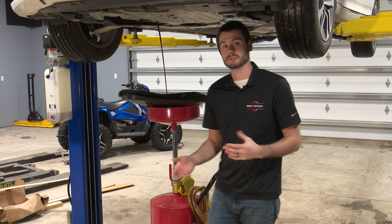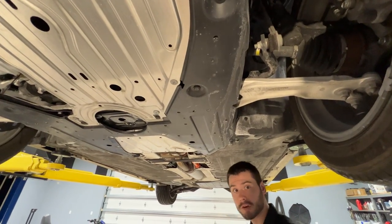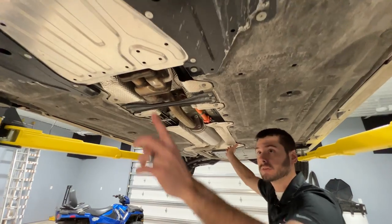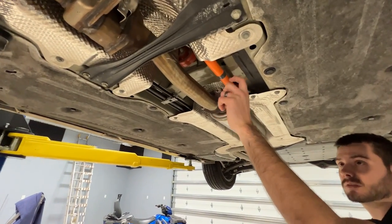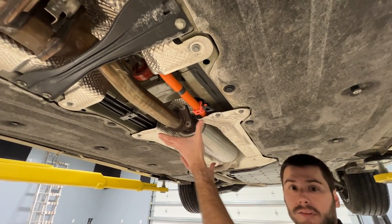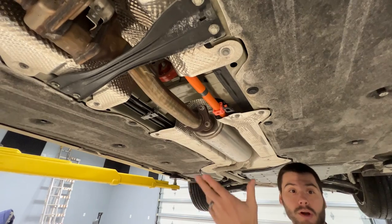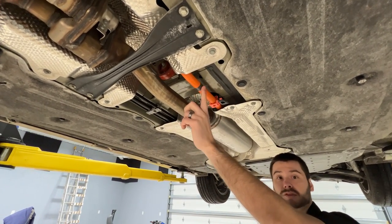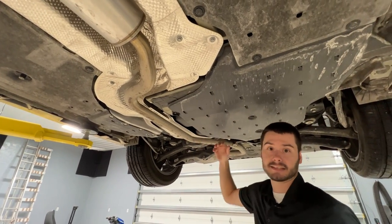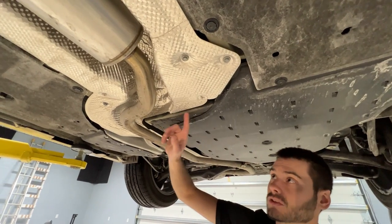There's so much room for activities underneath here that don't involve the hybrid electric system. The first thing we're going to look for under here is where's the orange cable, because somewhere we have to get from the engine compartment all the way to the back of the vehicle for the battery. We'll find that orange cable running in a plastic conduit in the innermost middle of the vehicle. The reason they do that is intentional — if you run it towards the outside more, it's more likely to run into an issue in an accident. You don't want an issue with the high voltage system in an accident. So they run it towards the middle of the vehicle intentionally, and it'll run back and end up going up through the body to the battery compartment, which sits above the gas tank in the trunk or back seat area.